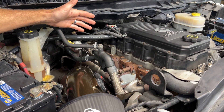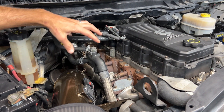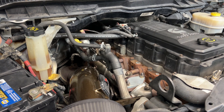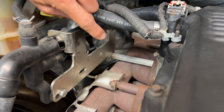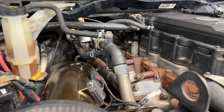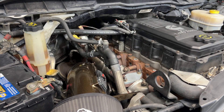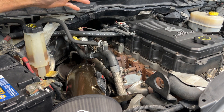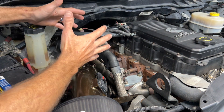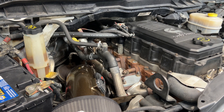Here's everything I was just holding in my hand, still installed in the truck. On on-road emissions trucks the EGR cooler is normally right here and all this stuff secures to it. Because this customer took the steps to make this an off-road race vehicle, he's removed the EGR cooler and used a bracket to try to secure everything, but it's nowhere near as rigid and allows everything to vibrate badly the entire time the motor is running. That eventually leads to this flex joint leaking coolant everywhere. Not only does it not look good, it's totally in the way for a second-gen turbo swap or a high-mount compound system, so we're going to eliminate all those problems with our coolant reroute.